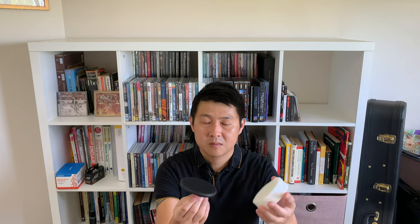Separately you need to buy these polishing sponges — same brand, Ryobi. It's a hook and eye system, in other words a Velcro system, so you just attach it and it'll spin around. If you don't have a Bunnings in your area, I'm sure you can get a very similar product at any hardware store. Another thing you're going to need is some masking tape or painters tape, just a little bit. And this is really another key item — I use this car polish called Meguiar's Scratch 2.0. You might be able to experiment with a different kind of polish, but this is a car polish designed to make the surface of your car nice and shiny, and I find it works really well as a polishing liquid.